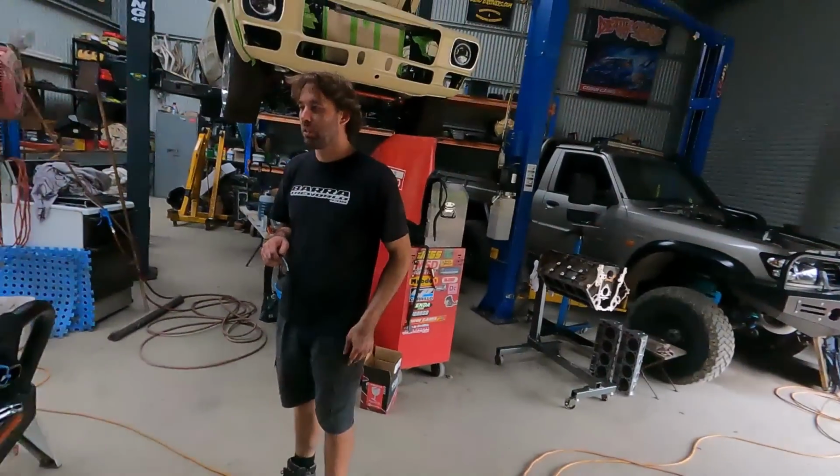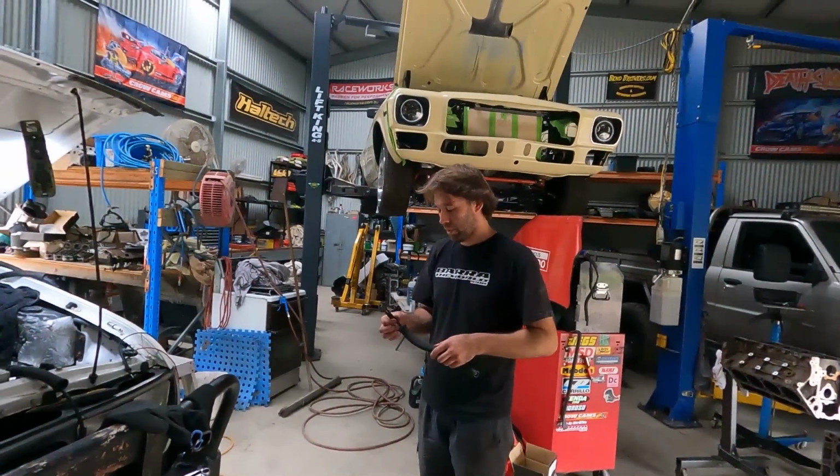We'll get it right on the dyno at whatever boost it's happily going to run and be fairly consistent. Like we talked about, it's not doing it on low boost, it's only doing it on high boost, which is why it's definitely a load related thing, and it seems to be affected worse by temperature. Pretty much always a lead when that happens, even though these are brand new. That's what it points to. If it still does it, we'll get it to a point where it's happy at whatever boost it is, and we can play around with the boost settings at the track tomorrow. At the moment, we just want to get away so that we're not driving really deep into the night, because I'm already really tired.